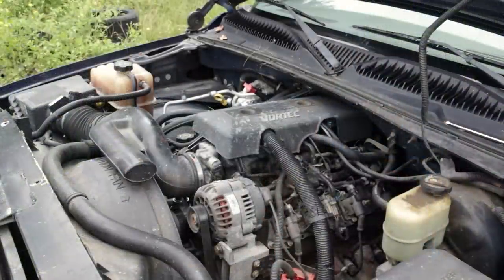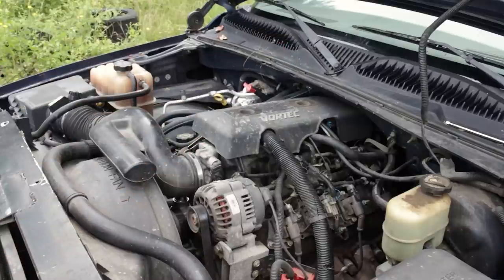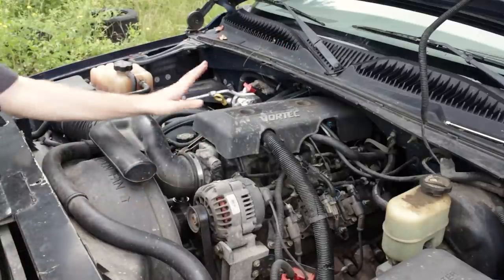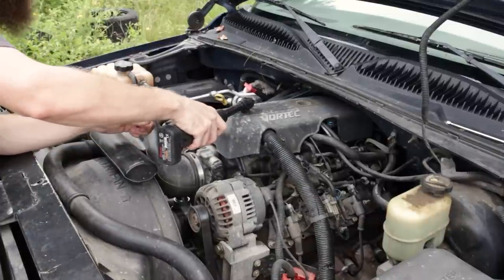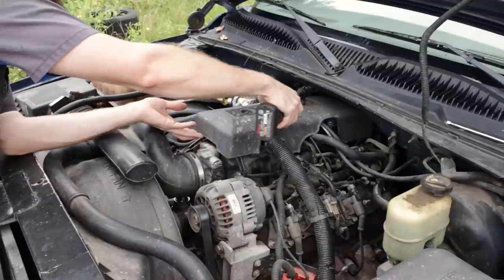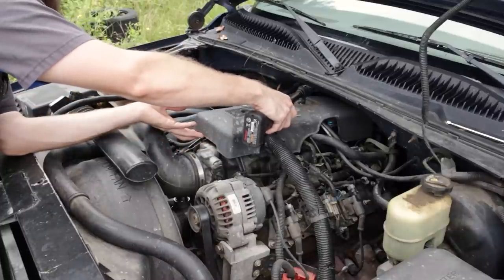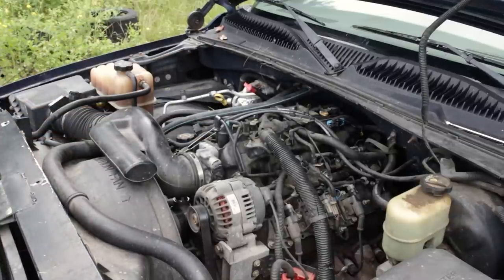With this repair as any other, always recommended to disconnect the negative battery terminal before beginning. Always want to have a pair of safety glasses on. Protect your eyes, you only get two of them. So starting out, we're going to go ahead and remove the engine cover. We've got 2 8-millimeter headed fasteners. Set that to the side.